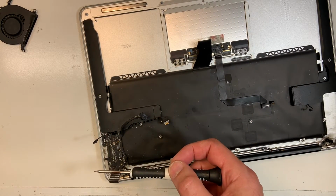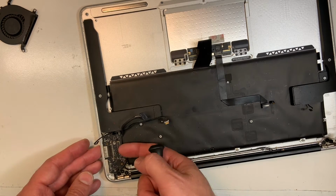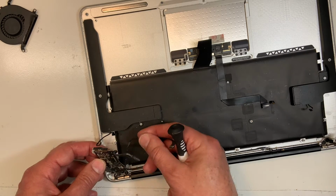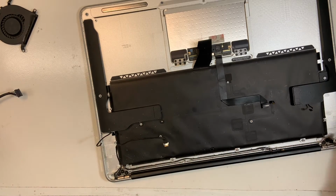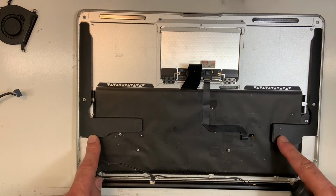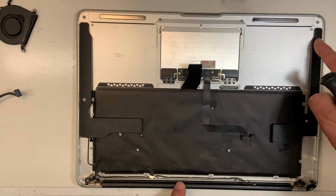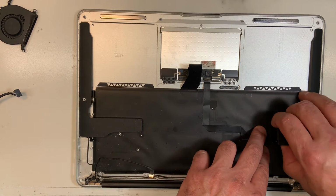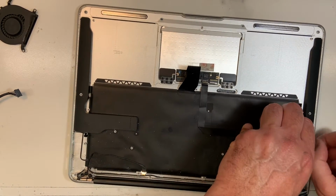Again, put it aside, pull on it gently, it should come out. The camera cable runs a little bit underneath. There you go, perfect. Okay, now next I'm gonna remove the speakers. Speakers are only glued, double tape over here. It's not that difficult. If you apply a little bit of pressure sometimes, like that, it should come easily.